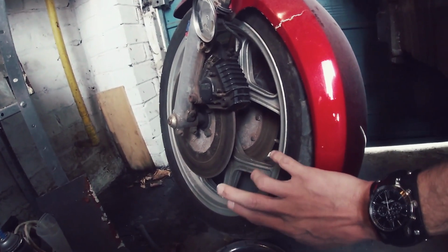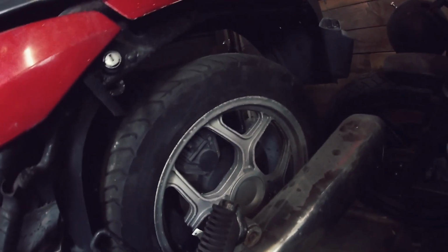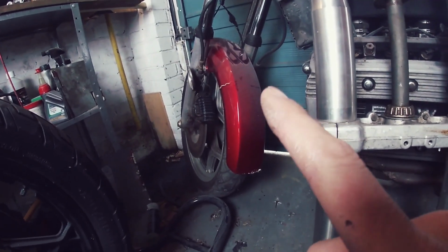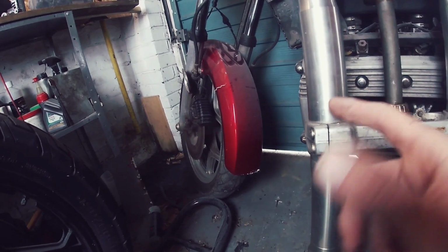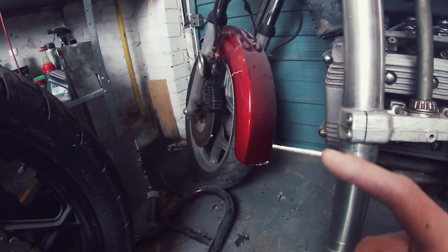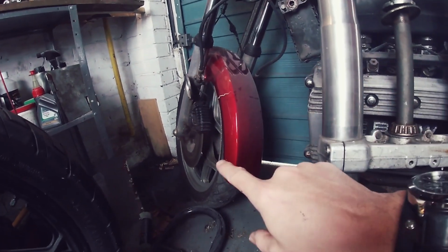Is because I specifically like these rims. There we go, there's another shot of the rim there. So for the wheels, all I need to do, same as what I'm going to do with the bearings on here, is you can get different bearings to suit different wheels, inner diameter and outer diameter, exactly the same way. So you get one with the 17mm inner diameter, and then the outer diameter to actually suit where it's going on the wheel, and then it will fit this straight away.